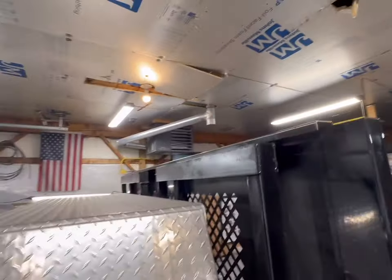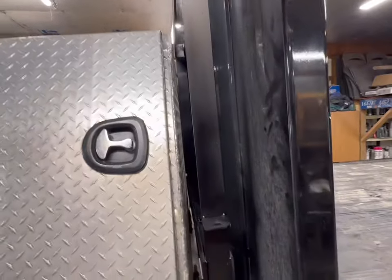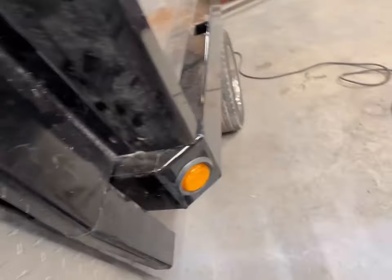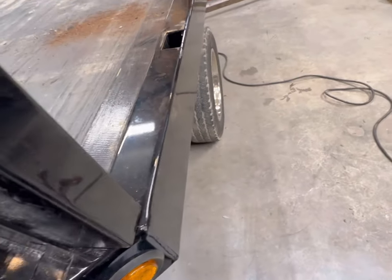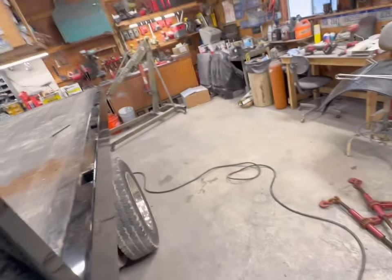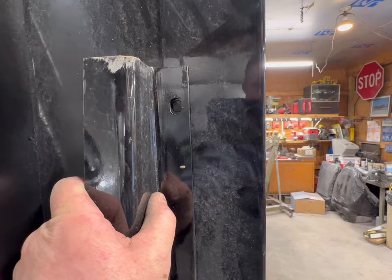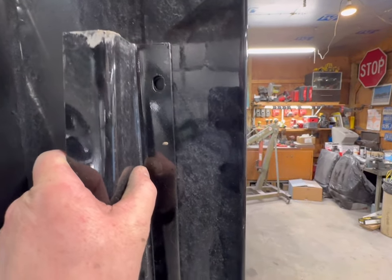The way this setup works, you can see there are the tool racks. They fit right behind the iPack there. Perfect little spot. Kind of fills that gap real nice. You can see we've got these two blanks. They're not drilled all the way through the sheet metal, but they're in the support, and what those are meant to do is be bolt holes. We've got matching bolt holes in these supports, so I'm going to use the bolts there. It saves me some painting, and I'm going to punch those, looks like 3/8 holes out.